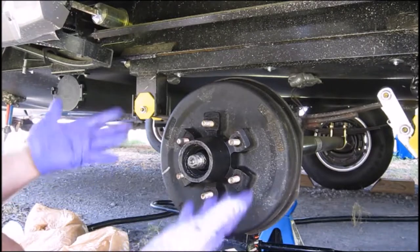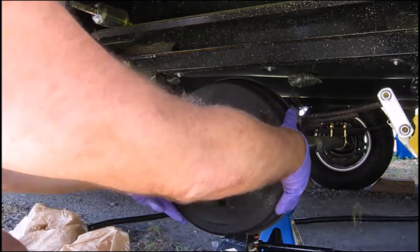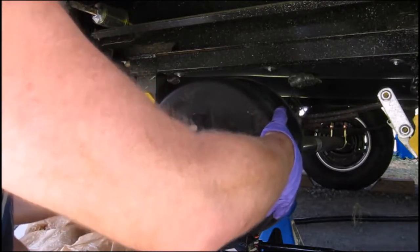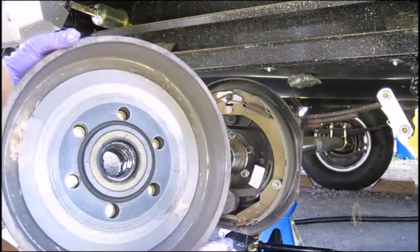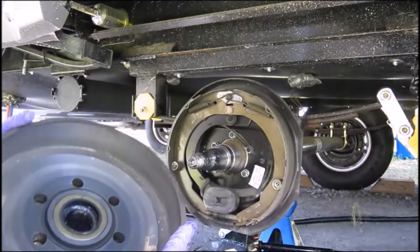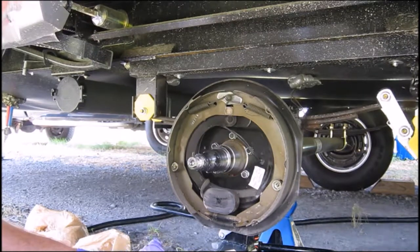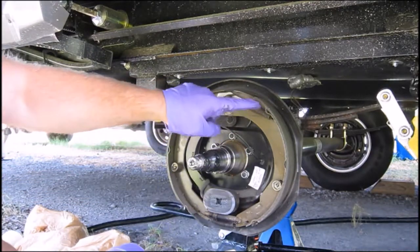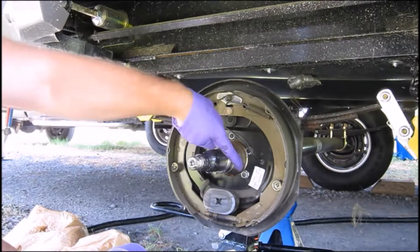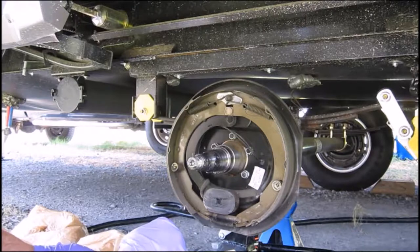After cleaning off the excess grease, we're going to hold the outside of the hub and pull this off. Now you have the hub along with the brake assembly on top of the axle tube. What I want to do is replace this whole brake assembly, which is held on by these five nuts here. I'm replacing the whole thing with forward-adjusting brakes.